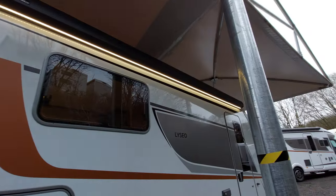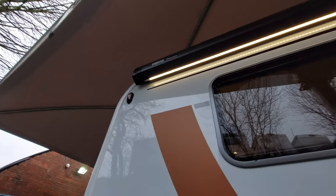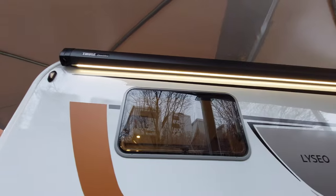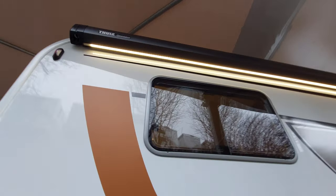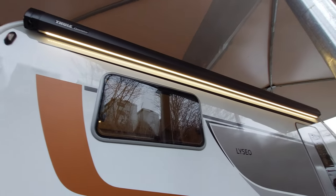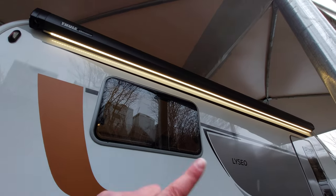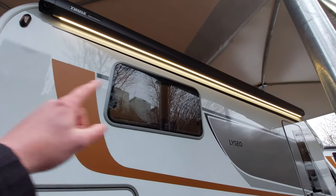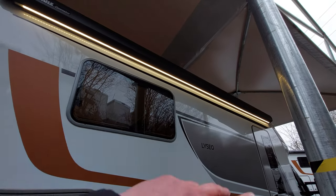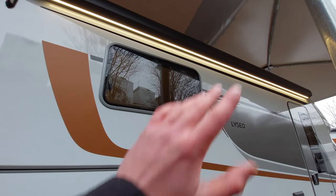On the side of the vehicle you've got an awning fitted right to the top. Your awning pole is located in the garage — it just connects in and you can wind the awning out. I'll send you a separate video showing how it operates. One rule of thumb with the awning: if it is windy, just take the awning in. Any gust of wind that gets underneath can potentially rip it off, damaging your van and potentially others. So if it's a windy day, take it back in.